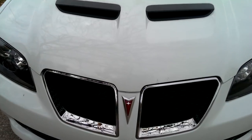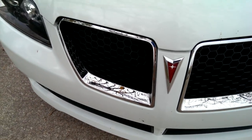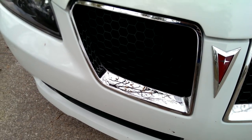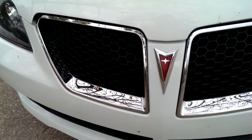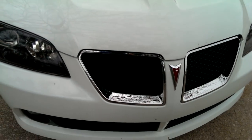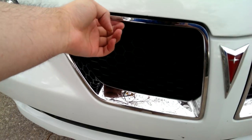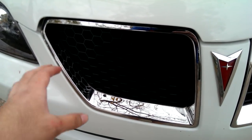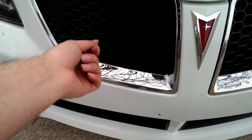Some people like to Plasti Dip the trim, and I found out why — because removing this silver trim, this fake plastic chrome trim, was very hard. You had to pry it off with a screwdriver. If you did the whole park-your-car-in-the-sun thing — there's no sun as you can see here, just a bunch of clouds and it was 40 degrees. So what I did was, once I got this pulled off, I pressed forward on this and pulled on this silver trim towards me. There's little notches on the back on each side where you can slip your finger in and pull, and they came off.